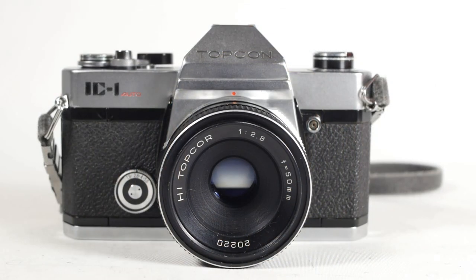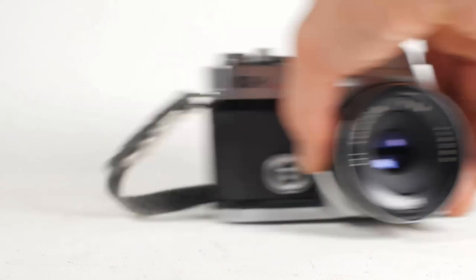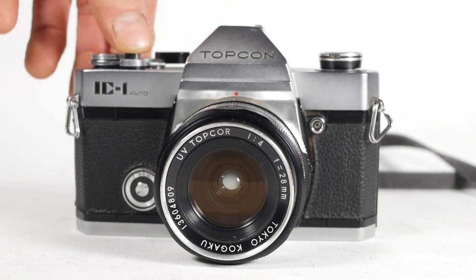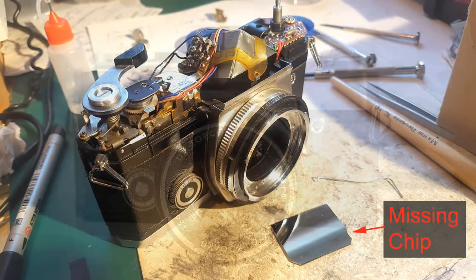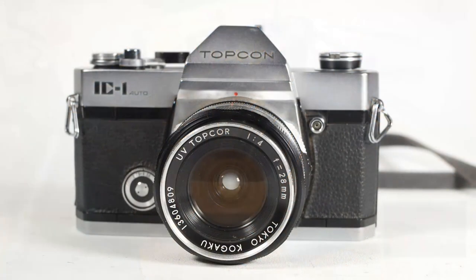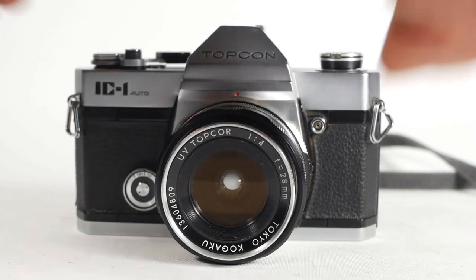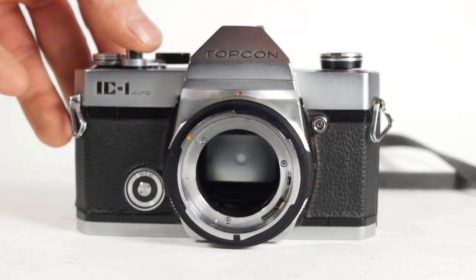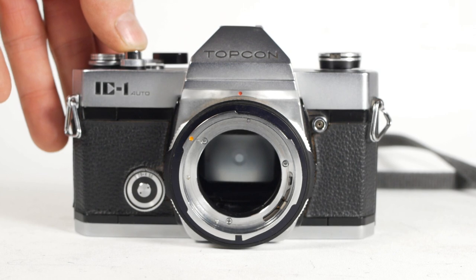I've got a film in my good IC1 at the moment, so I'll use the earlier spare parts camera for demonstration purposes. When this one arrived, the shutter didn't work even when you put batteries in it — this turned out to be just a bad connection, and now it works as it should. More significantly, the mirror was rattling around in the body with a chip out of its corner. Other than the chip, which was still attached to the backplate, the mirror was in good condition, so I was able to clean off the old glue and re-glue the mirror in position. I now have two working IC1s.